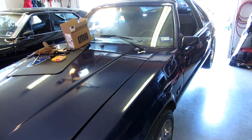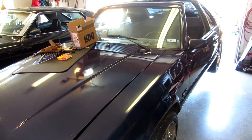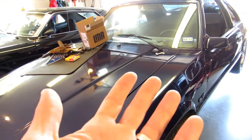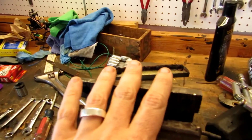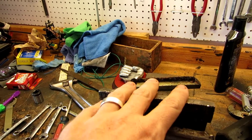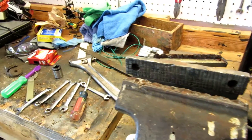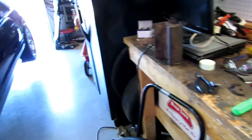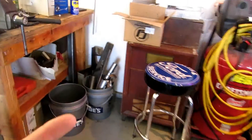I had the end caps basically too tight and couldn't move it. Thought I'd ruined it — thought there was something wrong with the bearings or the needle bearings in the U-joint. Took some time yesterday, put it on a vise, took the U-joint caps off again, greased them up really good, put them back in and used the vise to crunch them in. It ended up working out much, much better and it fit just fine. That saves me from having to go out and get another U-joint to fit the new yoke.